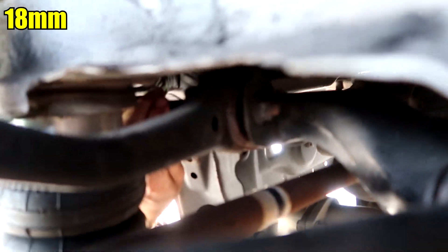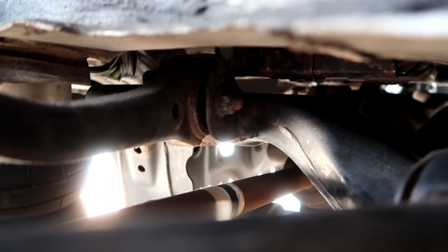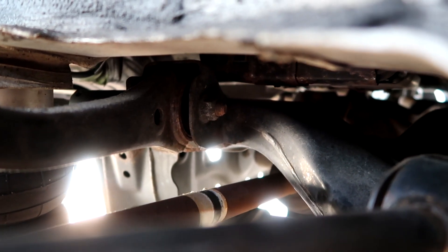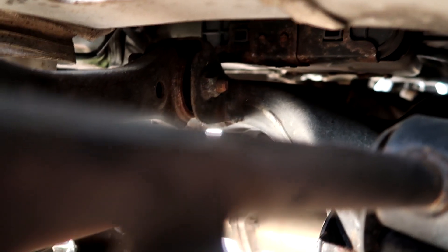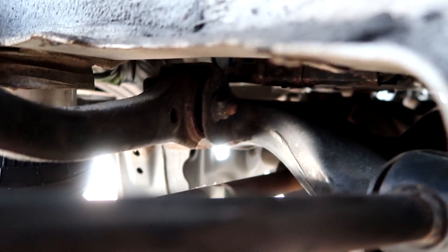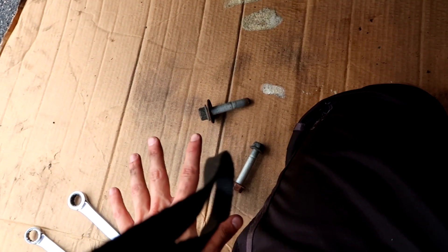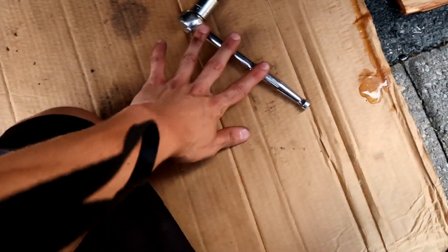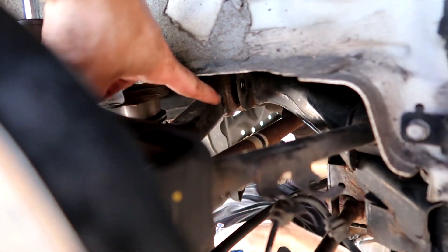There's a nut right there — I'll see if we can just spin out the bolt without dealing with the nut, but if the nut starts to spin we'll throw a ratcheting wrench on that side. The rear bolt for the camber arm is now out. It was tedious because we had to use three-eighths drive wrenches and breaker bars due to the very tight fit — no impacts or power tools could fit back there.